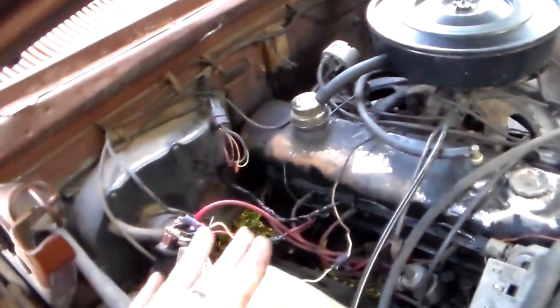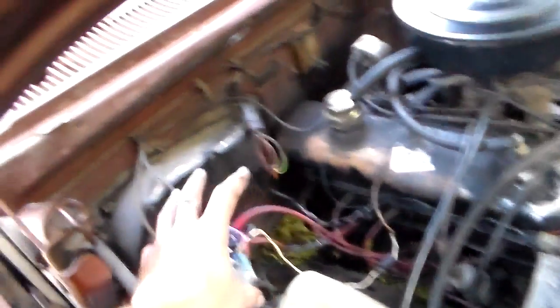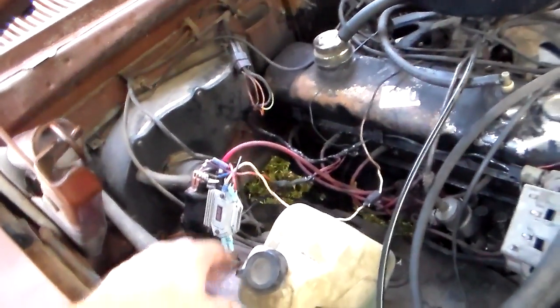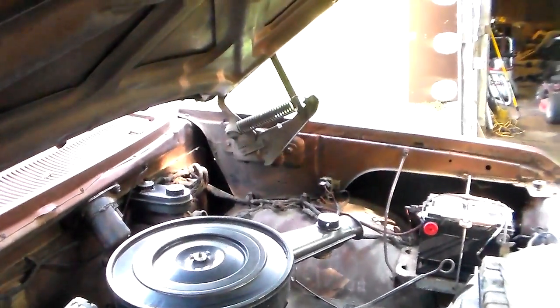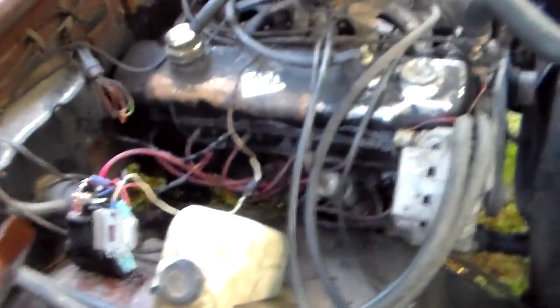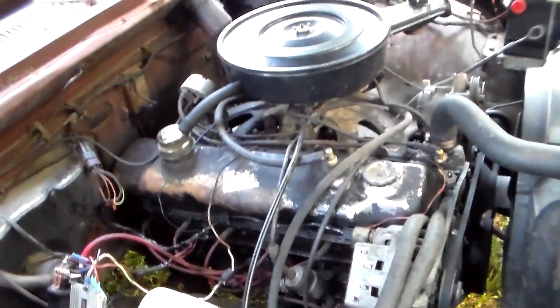It's a real nice setup here — the whole ignition system of this truck, besides the distributor, is right here on this bracket. Take the whole thing off in about four or five minutes, just two bolts hold the bracket on, take the wiring connectors off and that's it. I've eliminated a lot of headaches — no wiring going over to the box, no ballast resistor. I might come back and put a new distributor in eventually because the vacuum advance is not working on this one — I don't even have it hooked up. It'll run a little bit better with the vacuum advance connected.